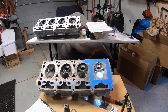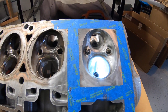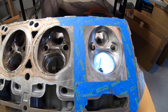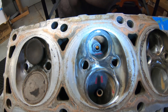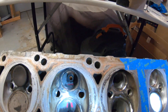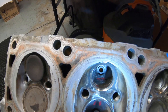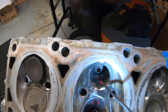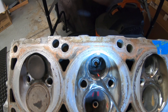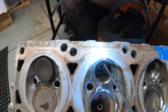Why leave the factory issue? You've got to add exhaust duration to your cam. Take a look at this top-down view from the chamber where I have marked red specifically on the exhaust — and hopefully I can get the camera in there — but this area right here, it is a straight shot down. You're thinking, well, that's a straight shot, it's going to have good velocity — yeah, absolutely.